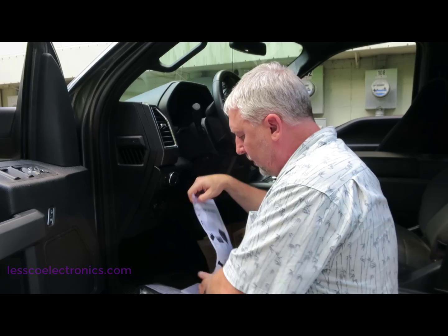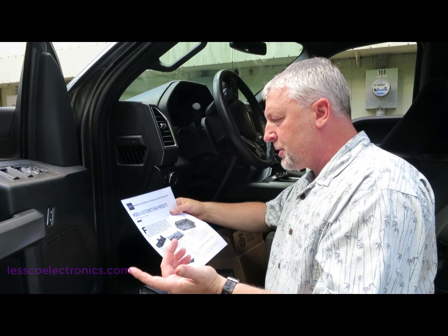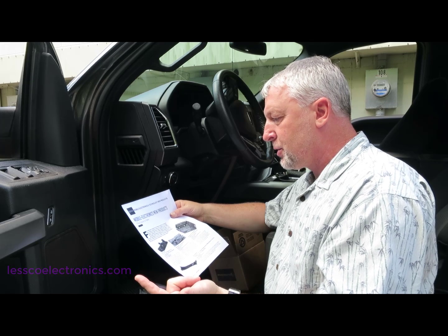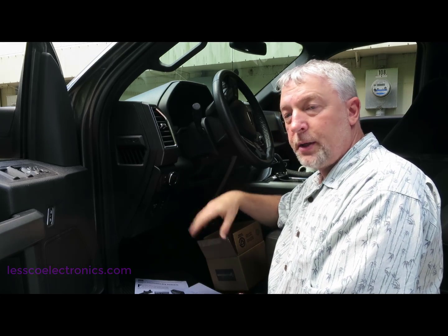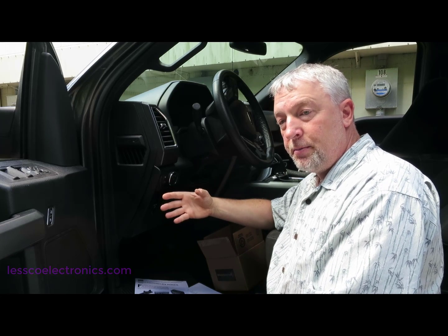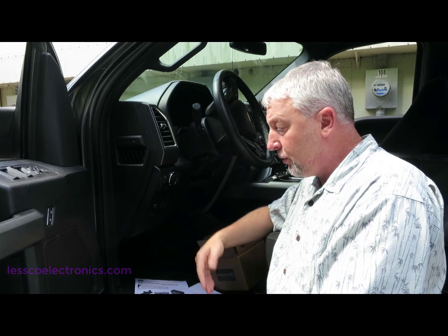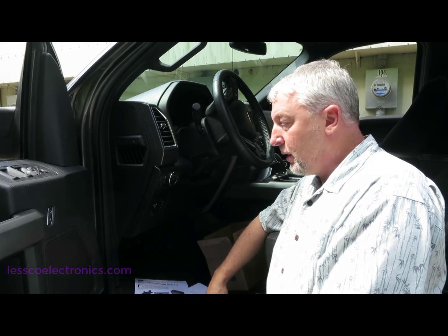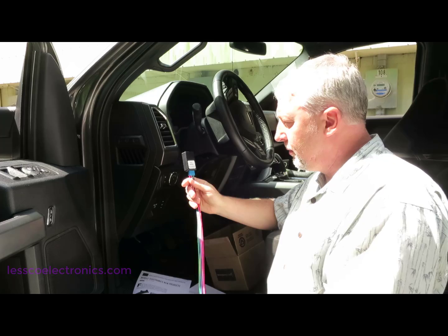This vehicle can benefit from it, and I'll tell you why. There's a list — blind spot monitoring systems, backup cameras, lane departure warning systems, collision warning, and everything in between. The way a CAN bus works, it's a bunch of little microcomputers communicating to the host system to make all the functions of your vehicle work. It's not like it used to be with an analog vehicle with a couple of digital components. Now it's the complete opposite — it's a digital vehicle where people like me are trying to add analog components. What happens is it causes a bunch of weird chaos on the network and the vehicle doesn't know what to make of it. Usually instead of enhancing, it actually detracts a lot of the stuff that you need. Luckily, they've got black boxes like this to fix all these situations.